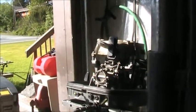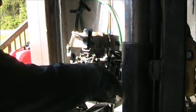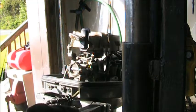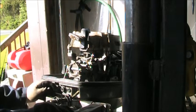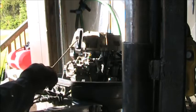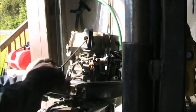In the tank, you're gonna see what I see. You see what she do or don't do. I squeezed the bulb. I noticed I got a little fuel leak right there where I stretched that tie-on line. That'll be an easy fix. I don't think it'll stop it from starting or anything. Choke works good now. We got her choked. All right, let's see what we get. Now I did squirt Tri-Flow in the cylinder, so she's gonna be smoking.